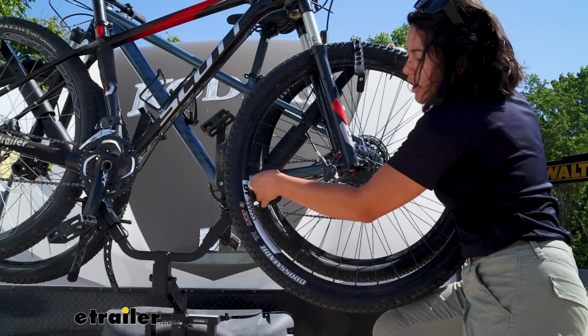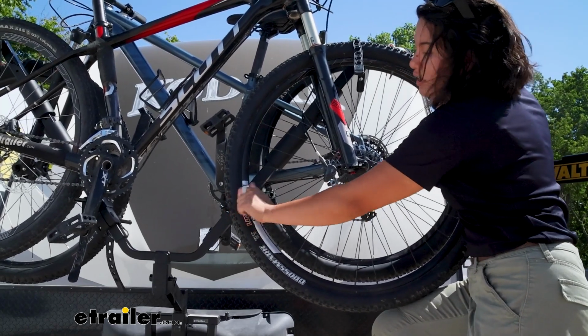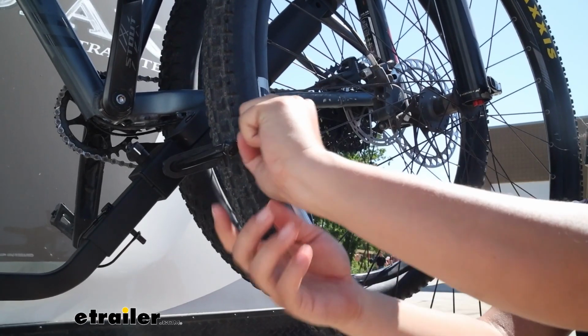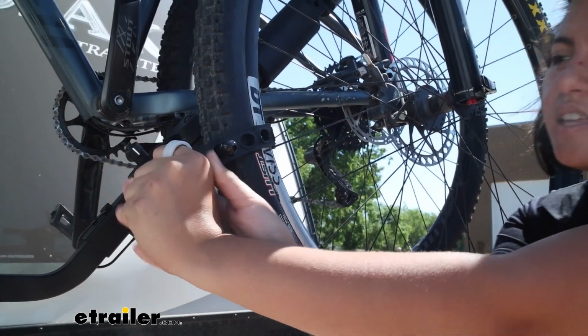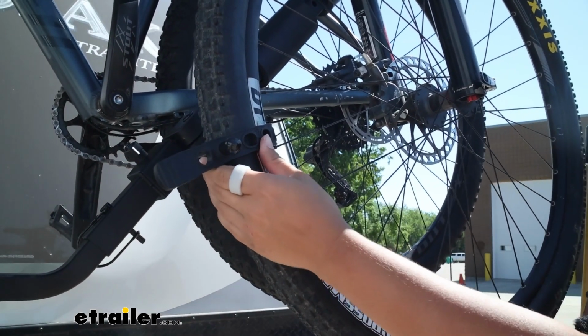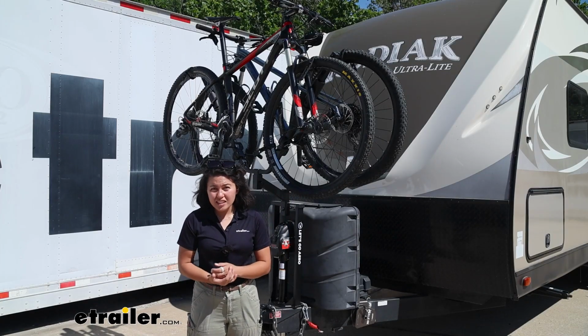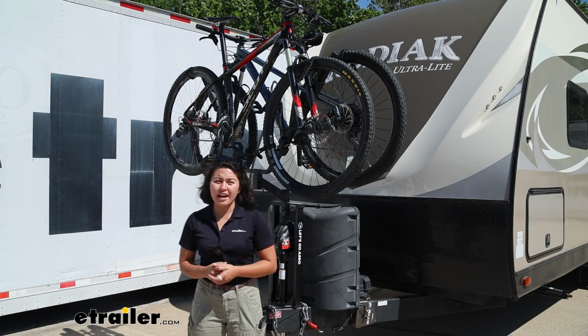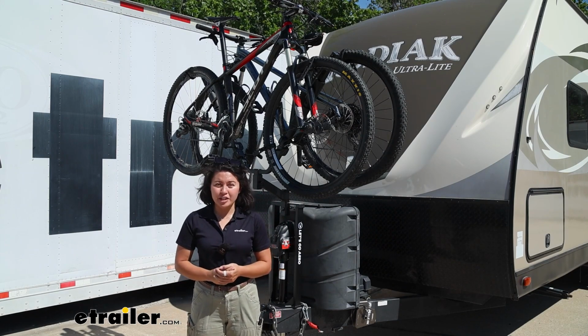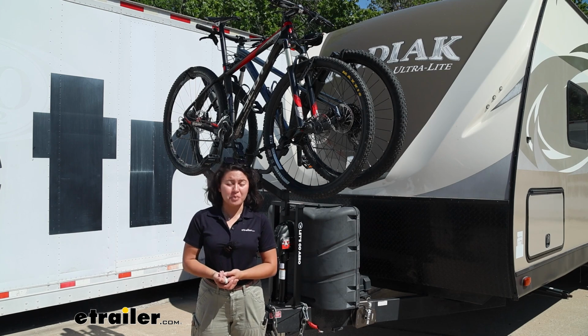The most important thing is getting your front wheels having at least those 2 points of contact. Hold these as tight as you can get them, because that will give you the best support. So this process is usually a little tricky even on a vehicle, so having this rack all the way up above your A-frame jack makes it a lot more tricky.